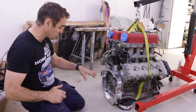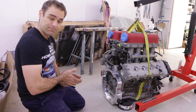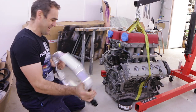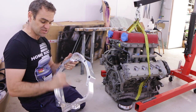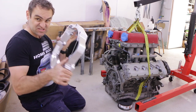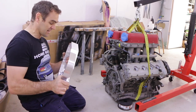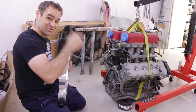I haven't actually fitted the dowels yet. I'm going to have to take out the studs and change it over to cap head bolts, but that's a simple task. We have a beautifully fitting adapter plate. I've also tried it on the Subaru gearbox — it fits. The dowels are a little bit tight, but even the engineers who made it stated they left the dowels a little bit tight because it's much easier to take some material out than to add material back. It is awesome, exactly the way we wanted it, and this is a big step forward on fitting a Ferrari engine to an Alfa Romeo.